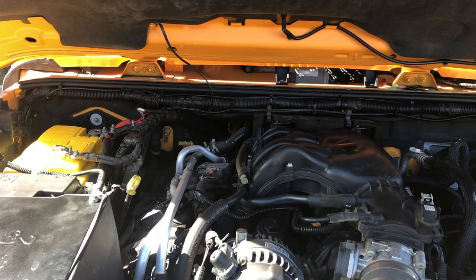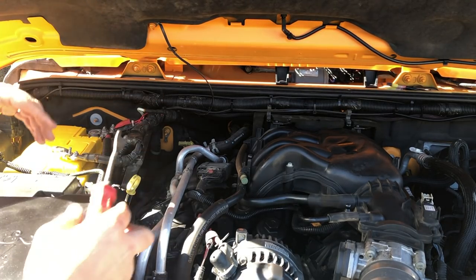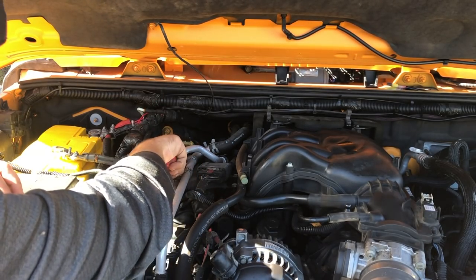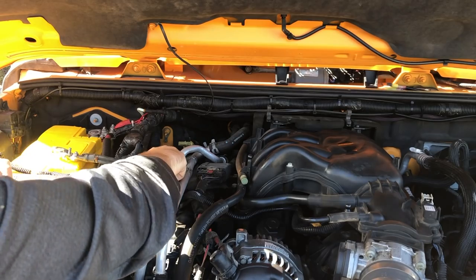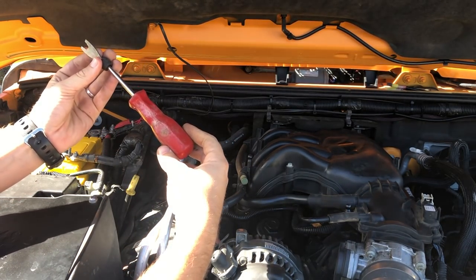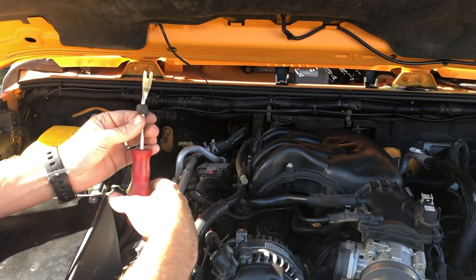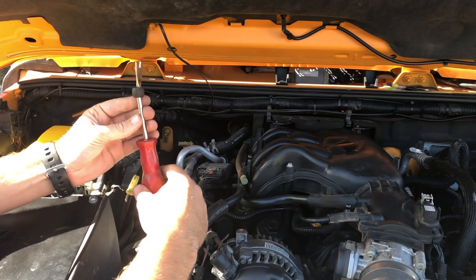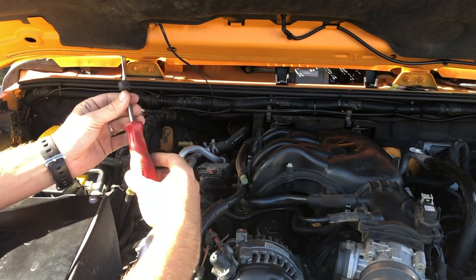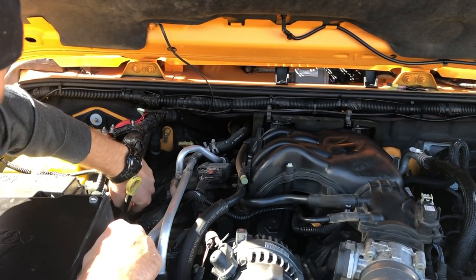So we'll start with removing this vacuum line here that's just connected with a Christmas tree clip thing. And we'll just pop that to get it out of the way. And for that, I'm using a clip puller. This thing really comes in handy on the Jeep because there are a lot of little clips. I will leave a link in the description to all the tools I use. So if you guys are doing this, you can at least get what you need for it. But with that out of the way, we can just pull that vacuum line out of the way here.